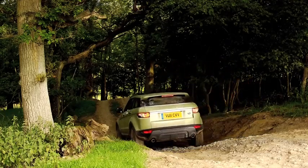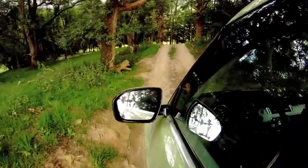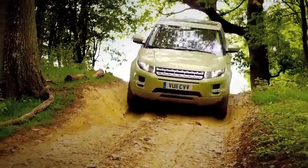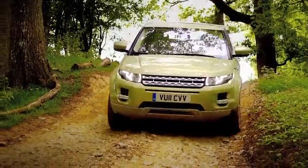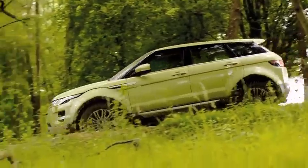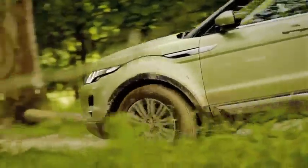Gradient release control slowly releases all of the brake pressure that I held under my foot brake, and the car slowly accelerates up to the hill descent control target speed. I've selected the minimum target speed for this particular track, but you can adjust the target speed up to 20 kilometers an hour using the cruise control buttons to whatever you feel comfortable with.